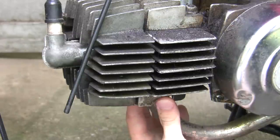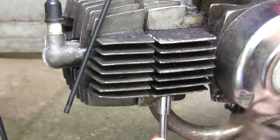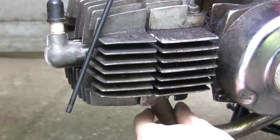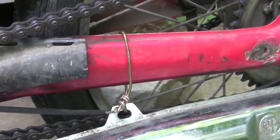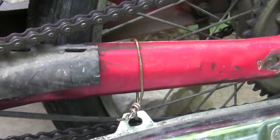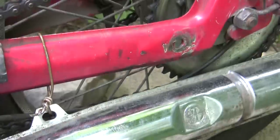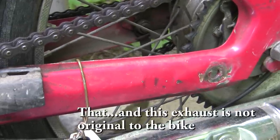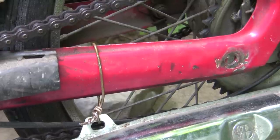Next we're going to take off the exhaust — one bolt on each side. You'll need a 10mm socket, a little one, and probably an extension. With some gentle wiggling it'll just come down. Your exhaust is now probably hanging and pivoting by one little bolt. On most Maxis, right behind the pedal arm, there's a piece of metal that comes out and that's what the exhaust attaches to. I have a Maxi-N so the bolt point is further back. I unfortunately don't have the connecting piece right now, so I've got a bent piece of coat hanger. Go ahead and take out that nut and bolt and then your exhaust should lift away.